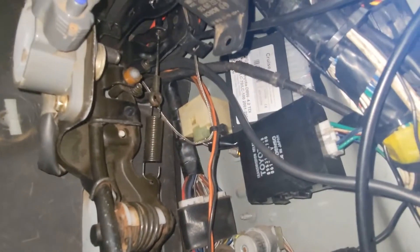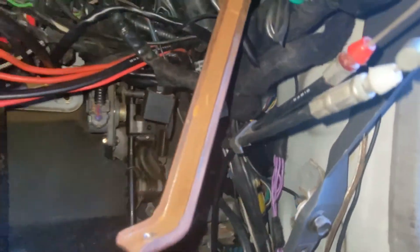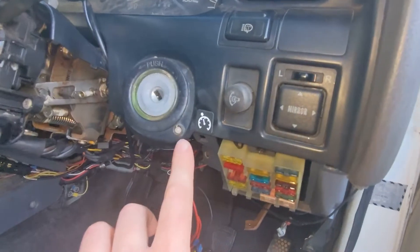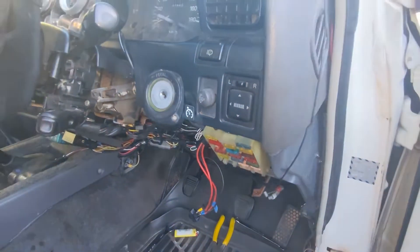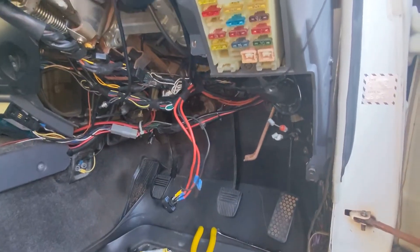The harness is all wired up now — tucked it in just behind there, above the auto trans relay, and the clutch harness goes above the steering column. You can just see it there — it's a nice little stopper, works awesome. For the cruise control indicator light I've just put it up here — this used to be my immobilizer light but I don't really see a need for it, so I've swapped it out for the cruise control light rather than drilling a new hole. Now I'll put the air ducting back in, all the bottom cluster plastics, and wire up the speedo.